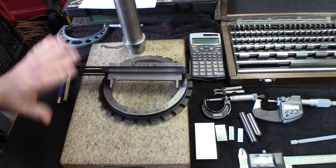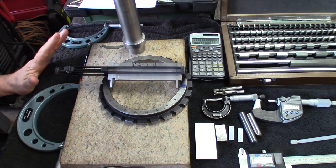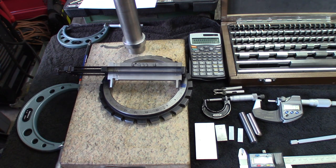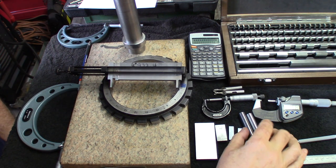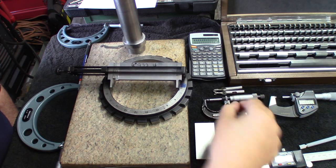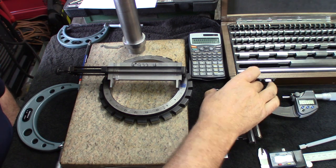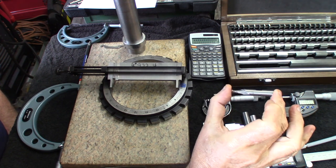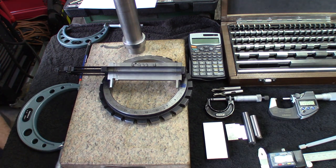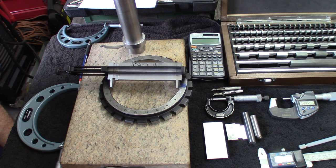To my appreciation, for a small machine shop, or a home shop, or a hobbyist, if you agree within 1/10 on your measurements and size diameter, you're very close. So I think the creative method here, using the stubs and the cheaper gauge block set combination, came to agree within each other. If you don't have 1/2 inches, 3/8 of an inch will do the job too. Just have to measure them pretty well with the micrometer. Either one will give you decent measures on this, and you will easily get not much more than a few tenths discrepancy between your readings. So I think that's pretty good.